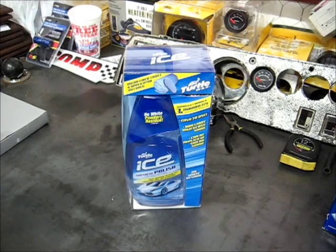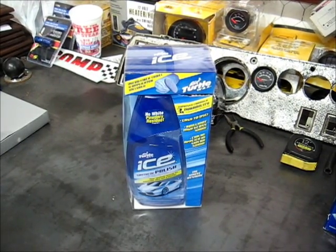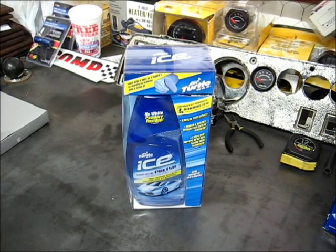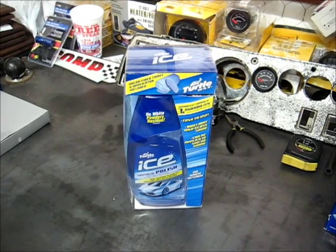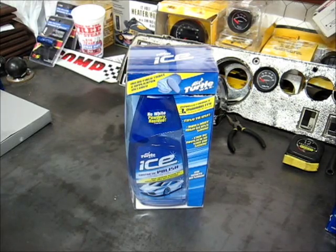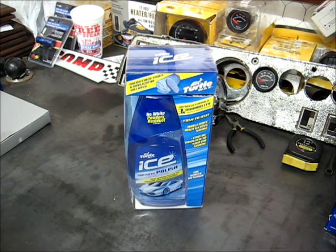We just did the video on the Turtle Wax Ice clay bar. If you go that route, they don't actually ever mandate in the directions to wash your vehicle afterwards. With their lube kind of being a detailer, you technically don't have to. I've actually done it and it turns out incredibly nice, but in theory, anytime you clay bar, you should wash your vehicle after it. Again, I kind of had to cut a corner. I made the time to polish it, and I was amazed how well it turned out, but I don't recommend that.